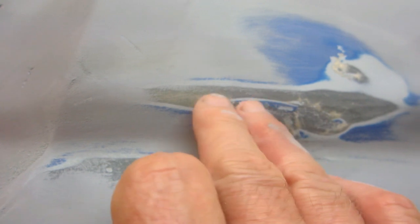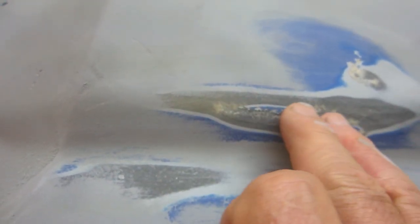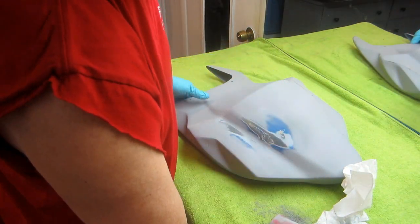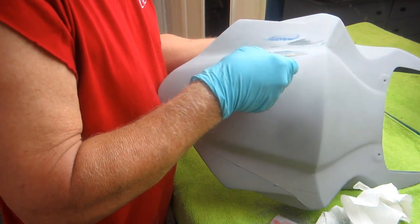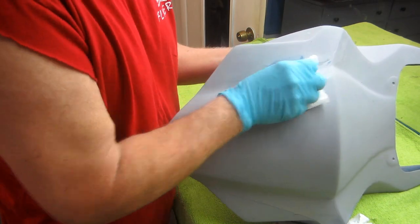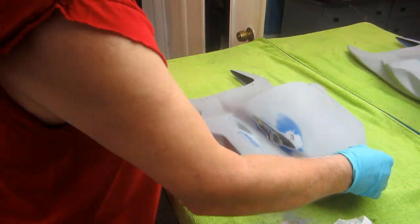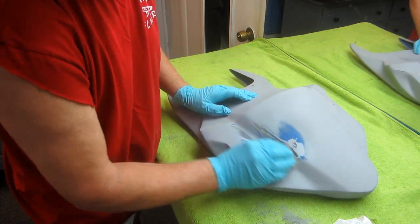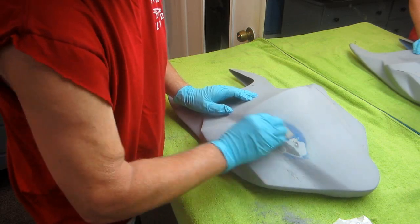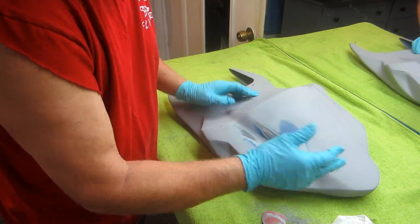One of the things that'll help this is — and I'm going to show this as a really good trick. I know we're down into the little chunks of cloth and weave. So what I want to do is seal that with thin CA, and I'll show how I do that. Whenever I've gone through down into the cloth weave, the cloth is going to have all little air bubbles in it. By dripping on a little CA, that's going to go down into that area. Don't hold the paper towel in one spot or it'll get glued. What that does is it seals it, and the capillary action goes down into the fiberglass cloth. The nice thing about working with CA — there's basically no dry time. We can get rid of that little bad spot. I'm always feeling with my hand, and that's going to be fine. That's going to be as good as it gets.